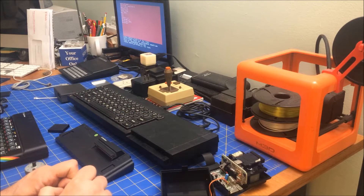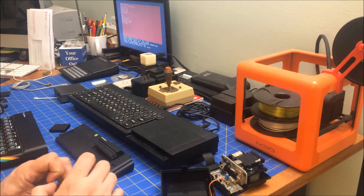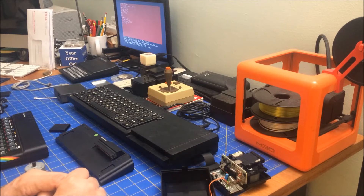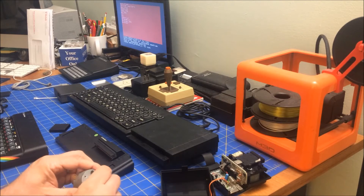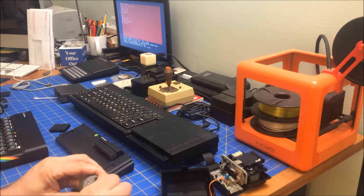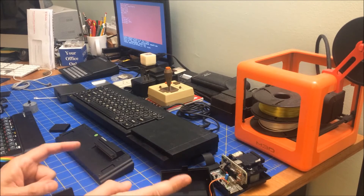At least it got the directory listing, which took a while to get. I have one other cartridge where it just tells me it's a bad medium, whereas here it was at least able to get a directory listing. There's something wrong with the drive and I think it could be the motor. I still want to run a few tests. Unfortunately I don't have my soldering iron here — I have it at the office — or my three-in-one oil. I might try replacing yet another motor to see if that has any impact, because this spare one spins really nicely.